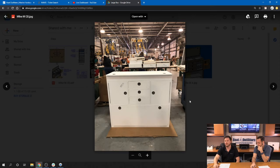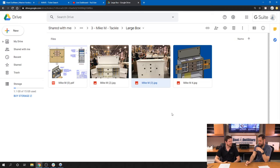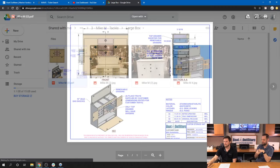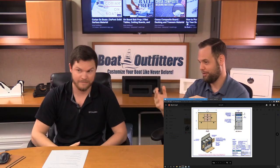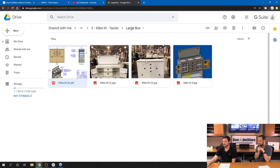You can see very open storage down underneath it — he had some big items that he wanted to throw in there. This poses some unique engineering challenges. When you add this much weight over an unsupported area, we really have to prevent drooping. So there are two or three box-channel stiffeners that run underneath the entire span of the width just to keep it all nice and level and supported. The cool thing when you're doing a big project like this is it really is starting from scratch — you're in full control over designing the part. I want X many Plano trays, I want a big open cubby, maybe for diving. It's probably one of the most fun parts of the job.